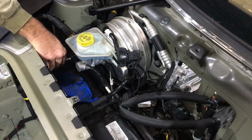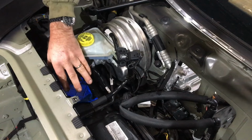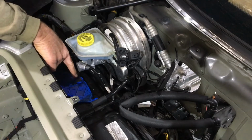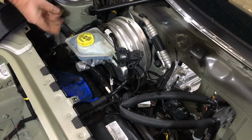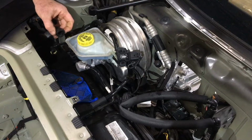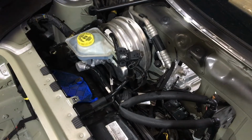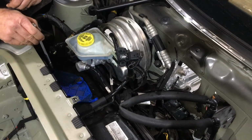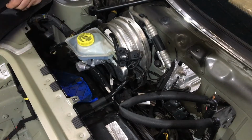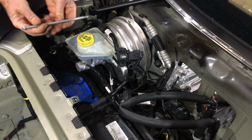To get access to these, and again I don't know how this will go with a left-hand drive car, on a right-hand drive car you've got the carbon canister here. It's pretty easy to remove, but simply it has a single screw just there, and there are a couple of connections on either side. These on the left hand side are just pressed. That one's a single side press. The other one here you press on both sides. You pull those out. This one here just pulls off, and then there's a single M6 screw that gets removed from there, and then you can see there's a pin that goes in here on the underside of it, and then you put these in here and rotate it around and put that screw in, obviously the reverse for removal of that. And that was the thing that gave me enough room to get access to these and pull these out.